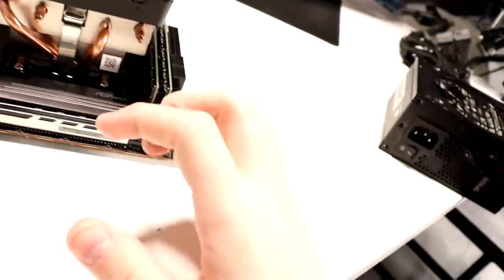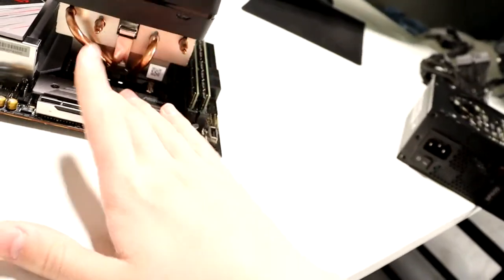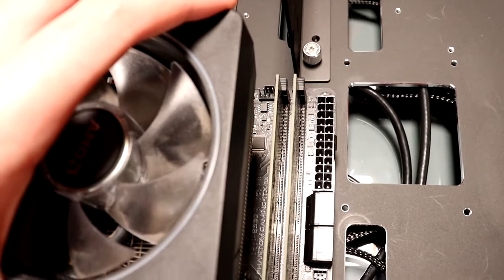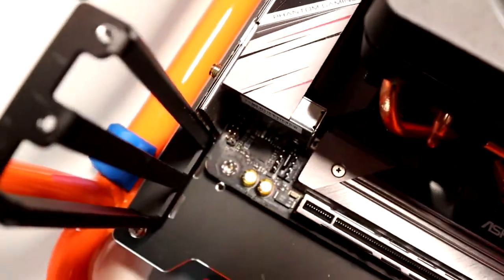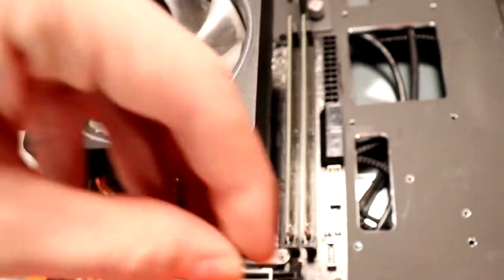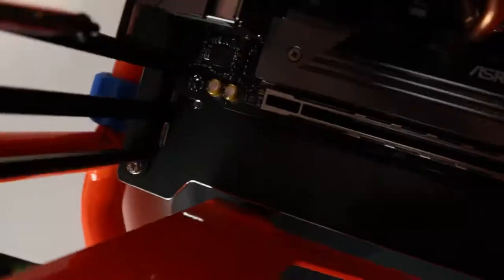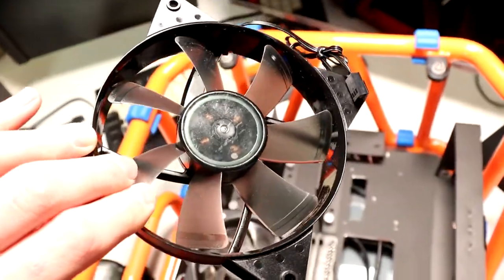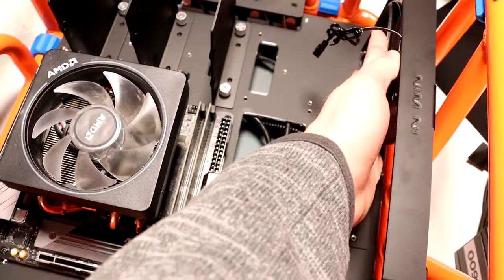I'm not going to do an M.2 drive — I can't afford one right now. I'm just going to use the hard drive that comes with it. This isn't actually going to be the final setup; I'm going to get the SSD later. For now, we're just going to leave the M.2 alone. Now we're just going to take the motherboard and place it in the case — make sure all the standoffs are aligned. Looks like they're all good. Let's go ahead and set our screws. Now we've got the motherboard installed. For the fans, we're going to use these CoolerMaster ones — just putting them in here to have some airflow.